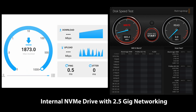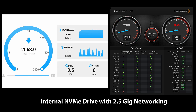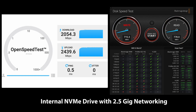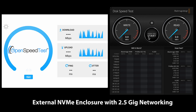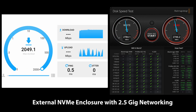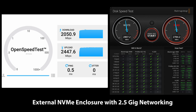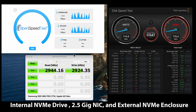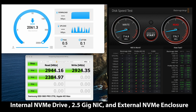The next test is the built-in 2.5 gigabit network adapter and the internal SSD running at the same time — and once again, it's not missing a beat, with no noticeable change in performance. The network adapter is running at the same speed I get when testing a dedicated 2.5-gig adapter. For reasons I haven't found yet, my test setup has a faster upload than download, but it's consistent for all devices I test at 2.5 or 10 gig. This next test runs the external NVMe enclosure alongside the 2.5 gigabit network at the same time — once again, no obvious differences even though I'm pushing a high-bandwidth Thunderbolt device. This was the most surprising test, pushing three separate devices to their limit without any impact to the performance of the other devices. For most users this would really be an exception, but it's comforting to know the device can handle it.